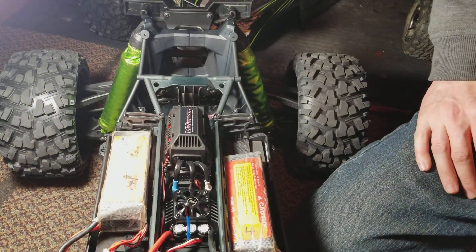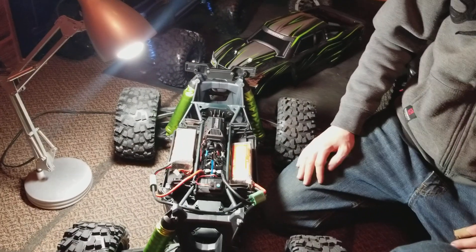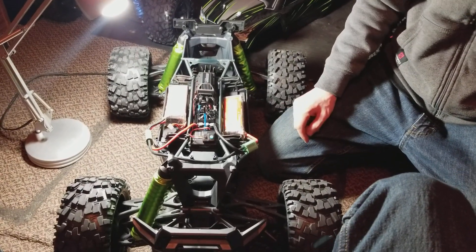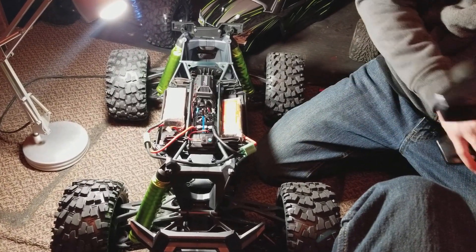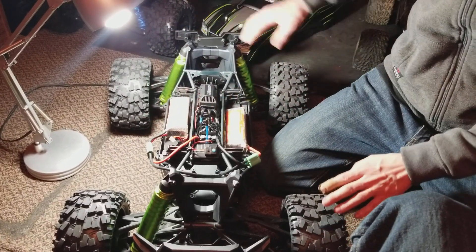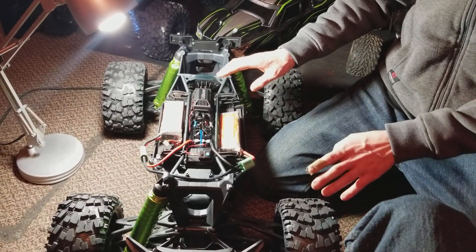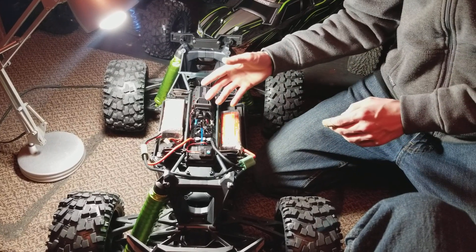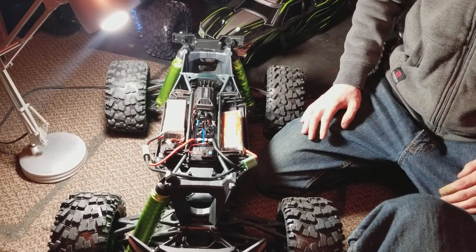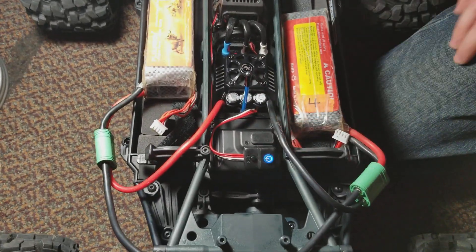Just wanted to do a quick video showing you how to calibrate. That weird little jerking thing the speed control did was probably the Traxxas Stability Management having a hiccup. I'm going to power it on one more time to make sure everything's working. Keep in mind: when you calibrate the ESC, for safety reasons remove all four tires completely. That way if it does freak out or you didn't quite enter calibration mode correctly and it goes full throttle, it won't go full throttle into the wall of your house.